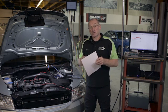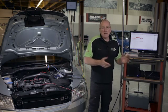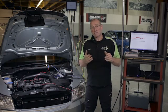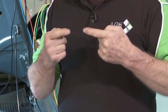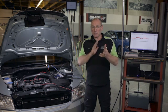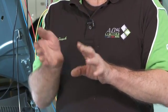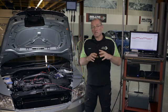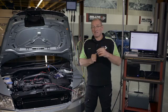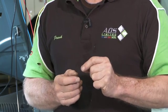Load request is the air mass meter which we've just discussed — we're going to bring the two of them together. The air fuel sensor, wide band air fuel sensor, or wideband oxygen sensor works off current differential across two cells. It's two zirconia cells and it's current differential — the exchange of oxygen molecules across those two cells which determines the correct oxygen content in the exhaust. The net result is that the ECU looks at current, not voltage.